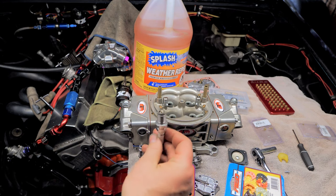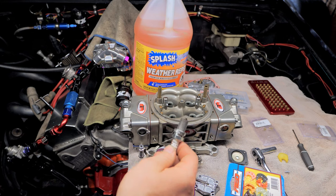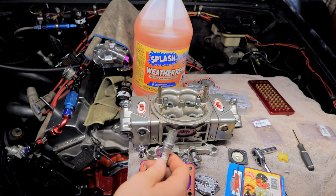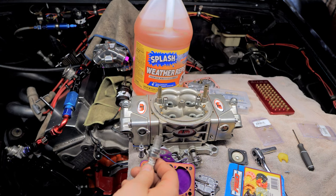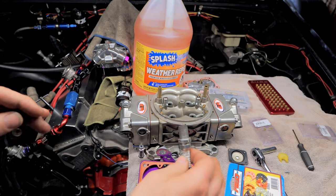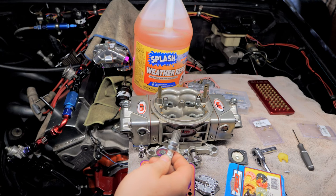You're gonna use your riding around plugs that you know aren't loading up. You're gonna take that to your test spot, right? Drive it all the way to your test spot. Always make sure your motor is good and warm before you make these hits. Shut it down, and as quickly as you can, I know this is a pain in the ass, as quickly as you can, change to new plugs.